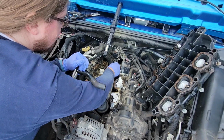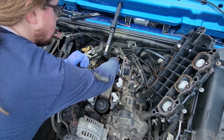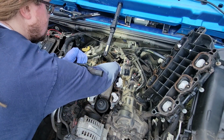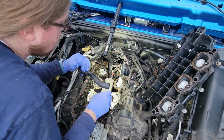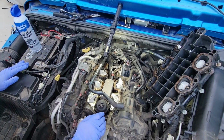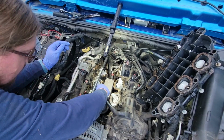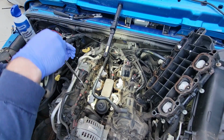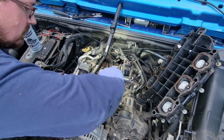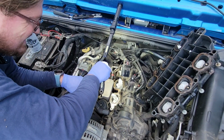As for these wiring connections that sit down in here, that's another good question. I don't know. There's a clip on the bottom of this one. There's a clip on this red one. I'm going to remove this oil cooler first and then see if I can undo those connections. These bolts look like they're an E8. And they are. So, big ass extension. Ooh. Okay, that was pretty simple. Ugh.